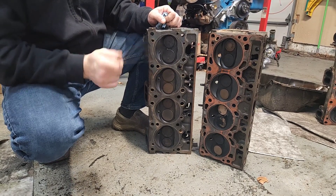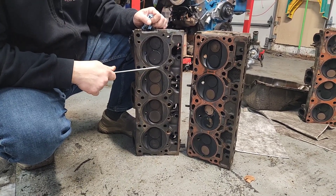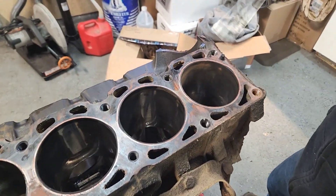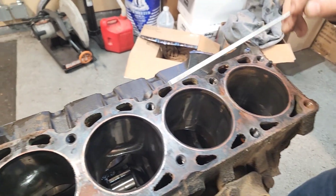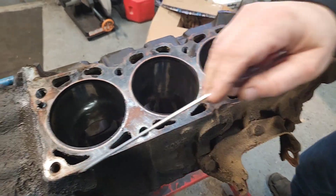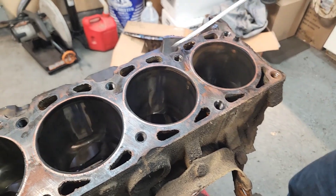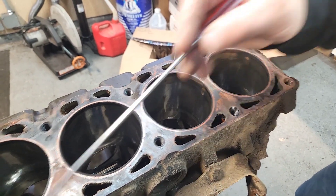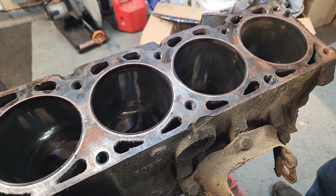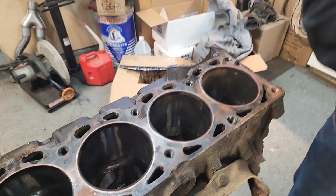What's the big deal about that? We have to look at the block itself where the gasket surface sits. Here we have a 301 block with the cylinder head off — we have our coolant windows going around the cylinders, and it's straight along the exhaust side. On a conventional 326 through 455, it's not a straight edge on the block — the block is actually scalloped just like the cylinder head, because those coolant passages are holes, not windows.